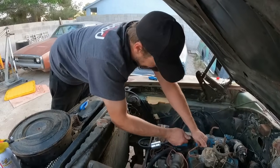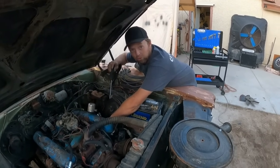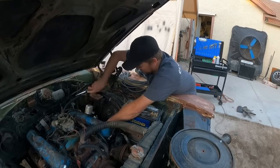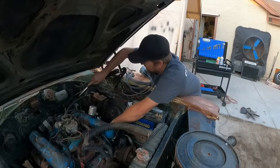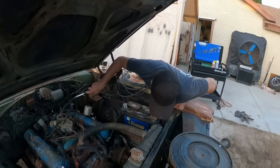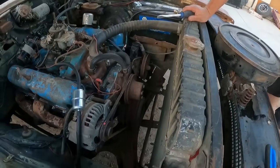I'm going to figure out where number one needs to be on the rotor. I'm going to spin the engine around, and when my finger goes poof over the number one hole, that means that one's on the compression stroke. So here we go. Oh, yeah, I guess it helps when it has power, huh? All right, that is compression stroke. What does it look like on the timing mark? Oh, that's almost right on zero. So, yeah, that's good.